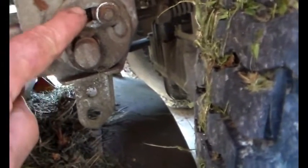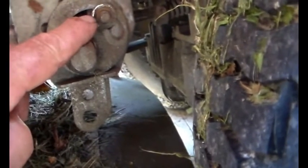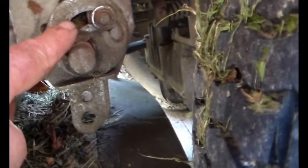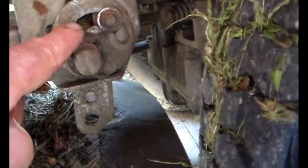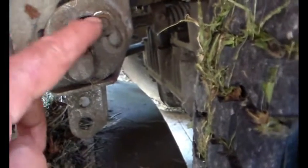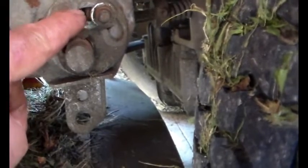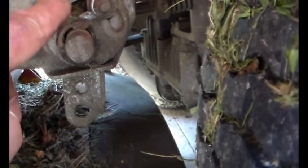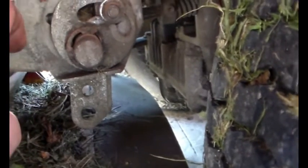it will move round. It was round here, that washer was round here, and I jiggled the deck up and down, and this whole cam plate moved round and lowered the deck on this side. Yeah, if this side is too low, then you'll undo it and jiggle it up, so therefore this nut or that cam plate goes that way, and the nut and washer moves round here.